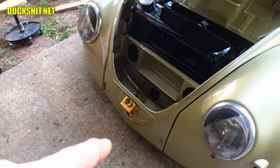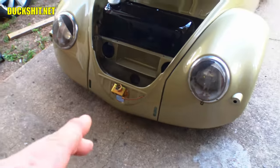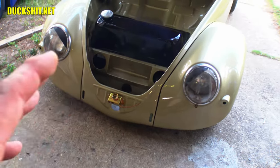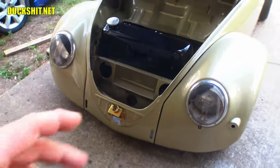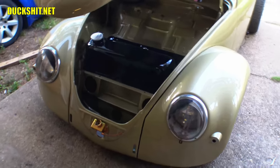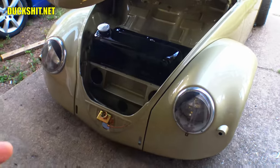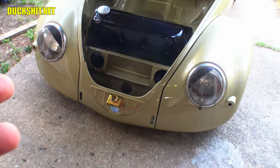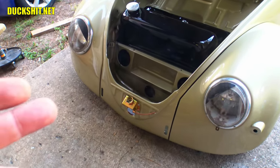We're also going to lube the inside of it a little better than what we've got in here, because I don't want that steel cable to eventually erode through the copper, and that probably will happen, because copper is incredibly soft compared to steel. And metal on metal is highly abrasive. Now, I could probably put some kind of a Teflon tube or something through it, or just even a plastic tube, and allow it to slide in and out on that. And that might last a whole lot longer, but I think it's kind of going overkill. I don't think that's what we're going to do here.